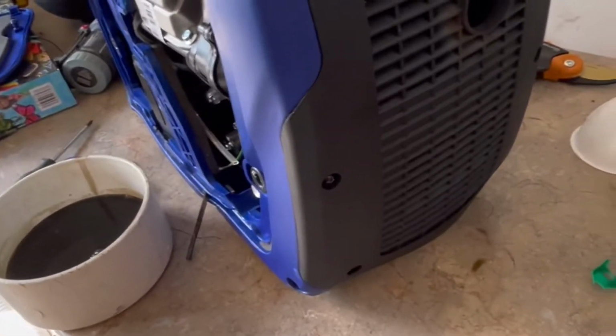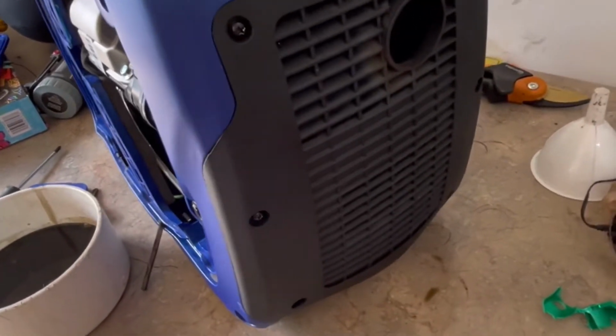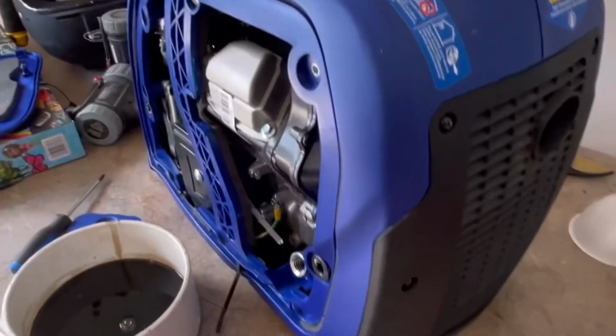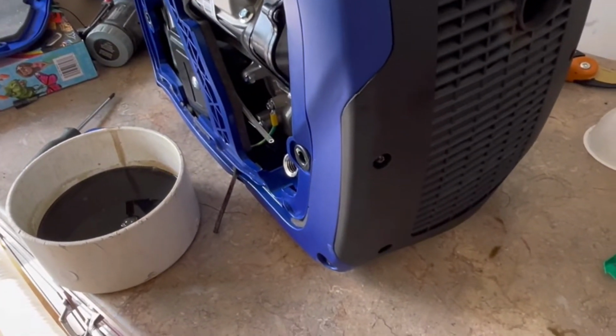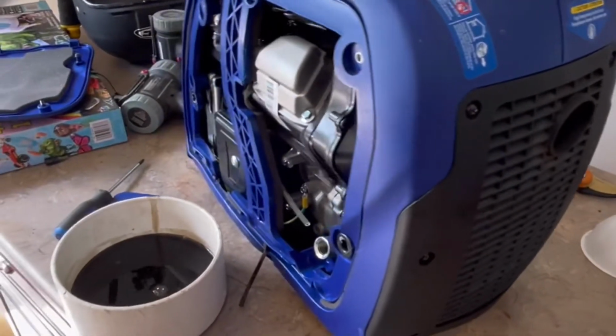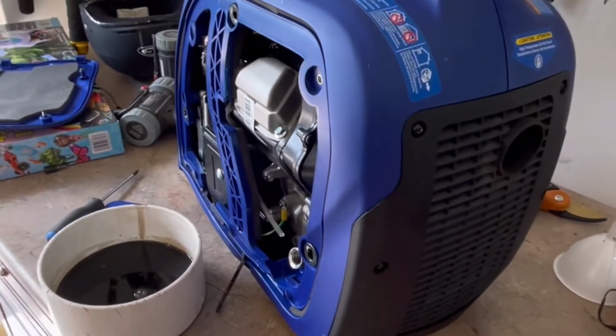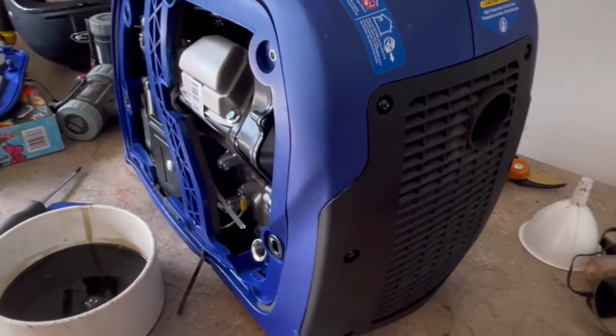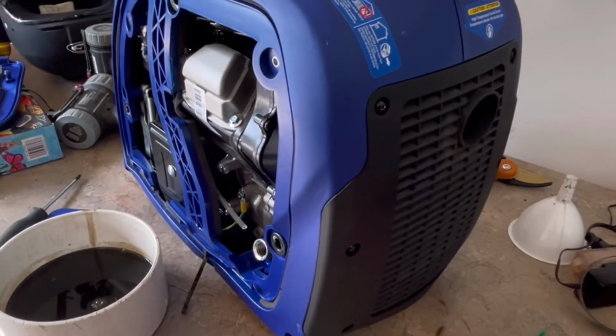You could not pump out, so the carbon just built up inside the piston. It built up inside the exhaust. It fouled the plugs and eventually killed itself. So took this off, took a few good hard pulls, and she puffed like a diesel for about 30 seconds as it cleared some of the carbon out of its system. And now she's back to normal.